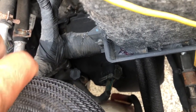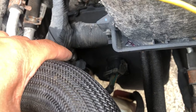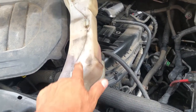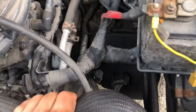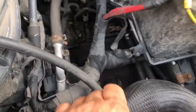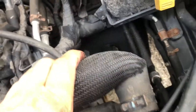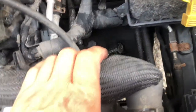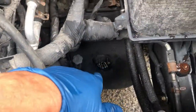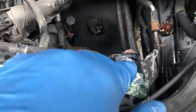Pull this hose out of the way to give more room, unplug that, and start taking the bolts off. There's no dipstick - just a cap. This piece just slips in, you pull up on it and pull it out in front of this hose. A guy could take all the battery tray off but I think there's enough room without taking the transmission line hoses off. I took the battery negative off and covered the hose to keep it from dripping.